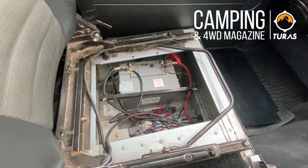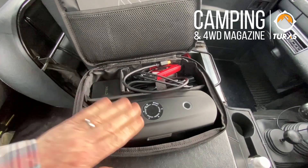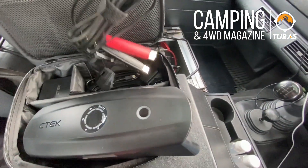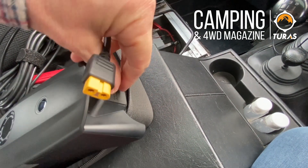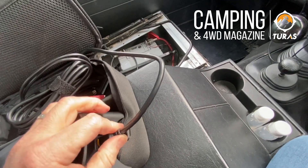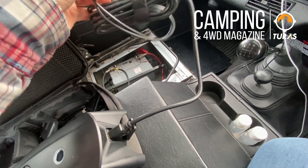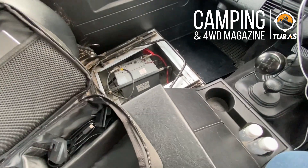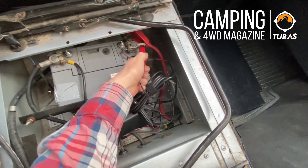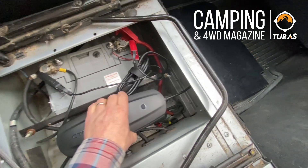Okay so here is the offending flat battery, and here is the CTEK CS3, which I'm keeping in this tidy little carry case that came with it. This holds all the bits and pieces that come with the CS3 unit. So all I now need to do is get the charging cable here and simply attach it into the end. There we go. That's attached in there, then get the two cables and attach them onto the battery and switch it on.